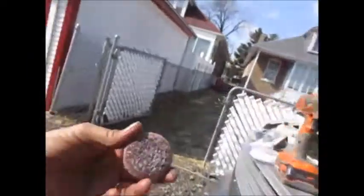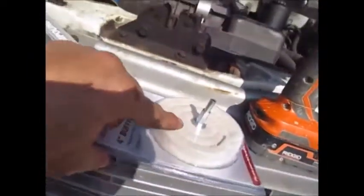So what I'm going to do is put the discs first on the little Dremel to scrape all the way around. The reason why I got the wheel lifted is so I could turn it and get all the way around. After I scrape it with the disc, I'm going to go ahead and put the polishing attachment on and polish it. A lot of people switch from battery to electric ones — the electric ones work really good. I do have an air compressor and angle die grinder, but I stepped on my hose and broke it. The back rim took me about 40 minutes — I did that one by hand with sandpaper and an electric polisher. So this one I'm going to do with my drill.